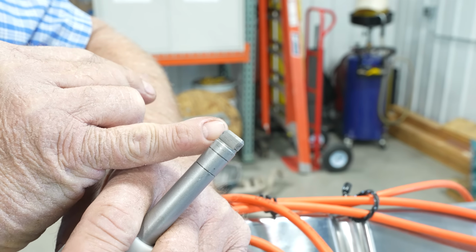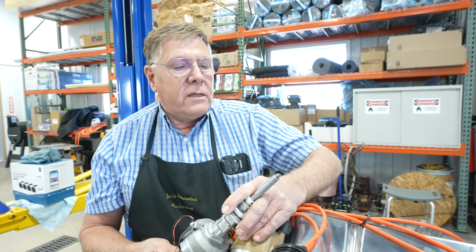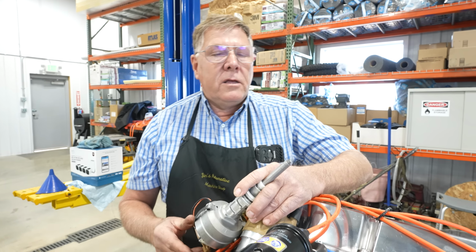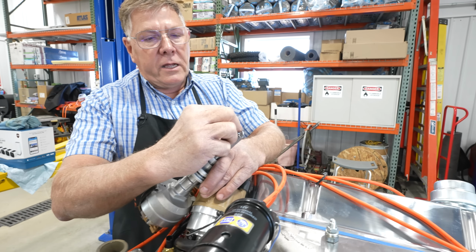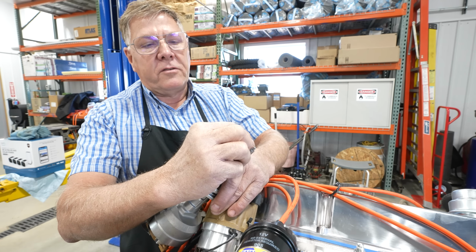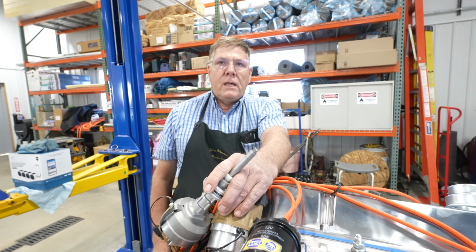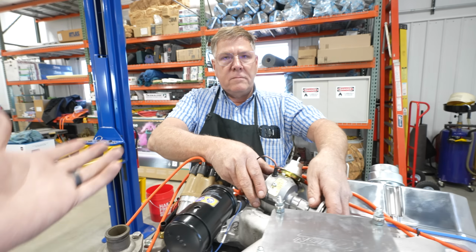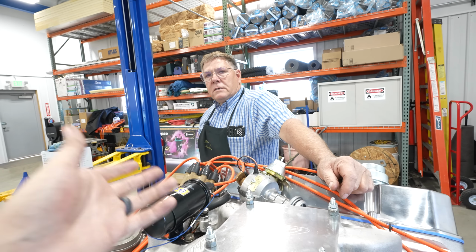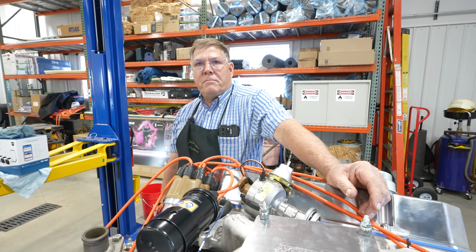Yeah. And I know at one point when we pulled it out, if you look real close, you can see that it's only shined up just the outside edges here. Which who knows, because it only ran for 30 minutes. But when I looked at the original stuff that came out of this engine, you could see a nice shiny wear pattern all the way across where you could tell it was fitting much tighter. Engaging a lot tighter. Yeah. But of course, at the time we didn't know if it was a distributor thing or the oil pump gear. We didn't know which side it was on. And it was the end of the day, we're out of time.